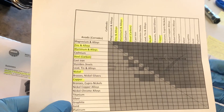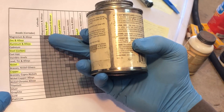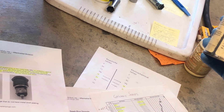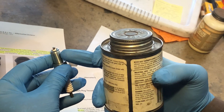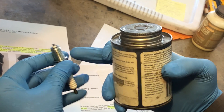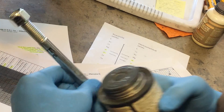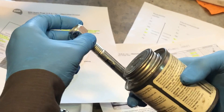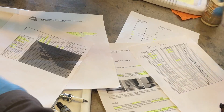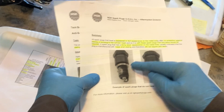The reason I advocate using anti-seize is that you get a double benefit. First, anti-seize contains zinc oxide and aluminum, which means you're introducing more sacrificial anode material — more of a good thing. Second, as I mentioned, you're also blocking the interstitial space and preventing electrolyte from entering from the combustion chamber side, so you acquire even more protection.